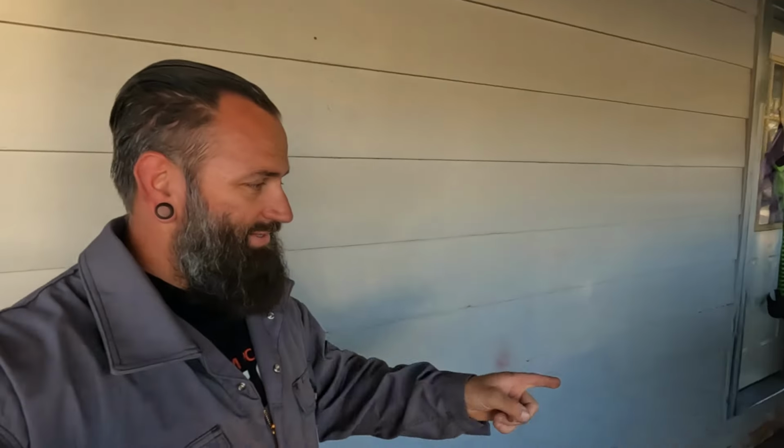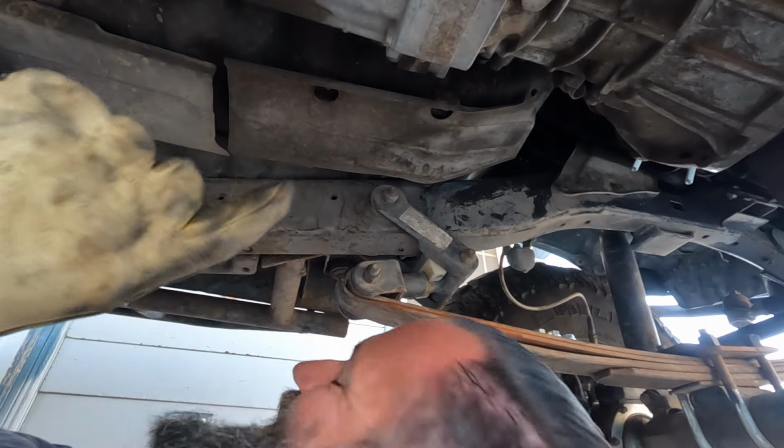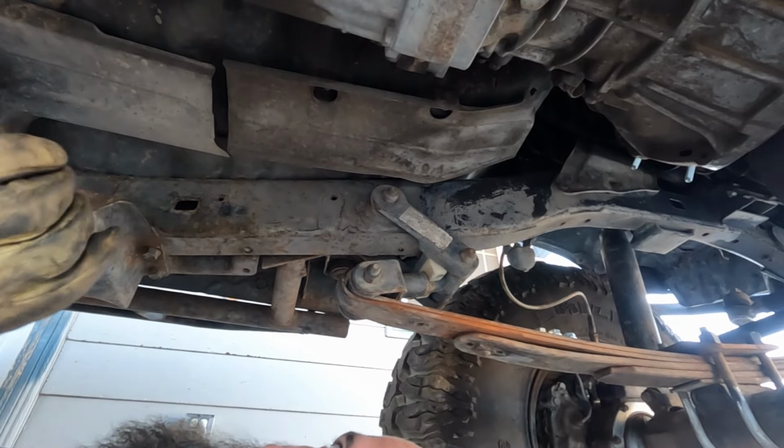Unintentionally, we just unlocked a little bit more horsepower because we went from that dinky 1¾ inch exhaust to 2.5. Or I guess 1½ inch ID to 2¼ inch ID. So I got that big Weber on there, which means I got more stuff going in. Now I got that big exhaust, so I should have some more stuff going out, which means more power, baby. Hopefully I can do this without knocking you guys off my front drive shaft.